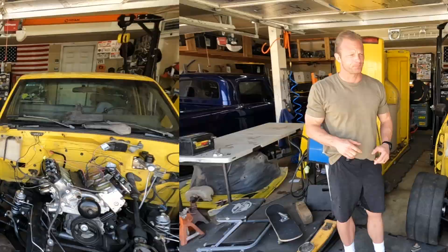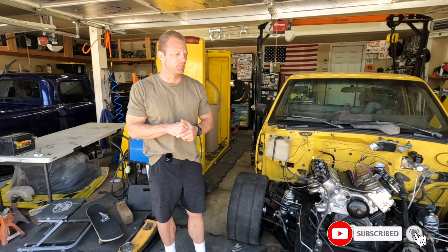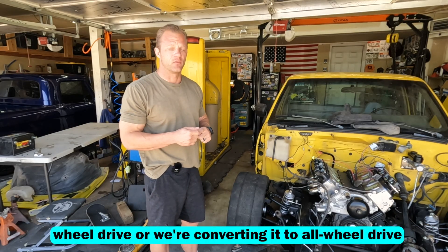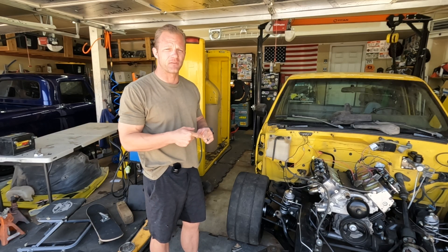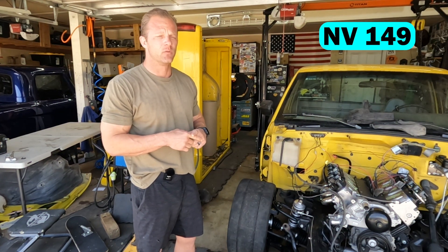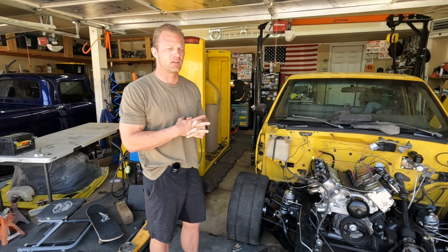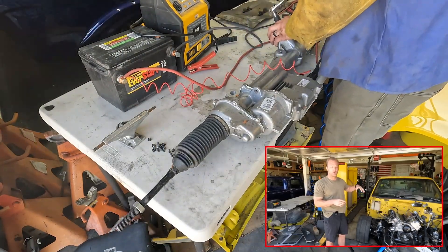Just to review, if you guys haven't seen any of these videos, we've covered this in previous videos - but what have we done so far? We have taken this single cab short bed K1500, which is a four wheel drive, or was - we're converting it to all wheel drive. So we added a front Denali differential, made some custom mounts to make that work. We've converted the transfer case to an NV149, which is an all-time, all-mechanical transfer case that pulls a lot of the electronics out of it. We've converted the rear axle to an independent rear suspension with coilovers.